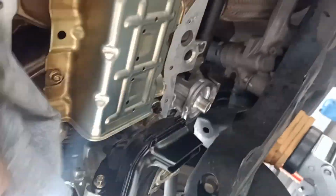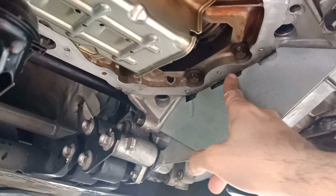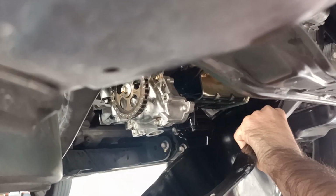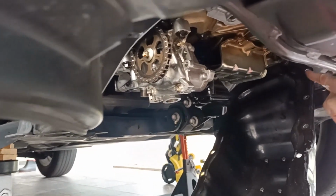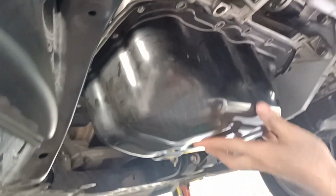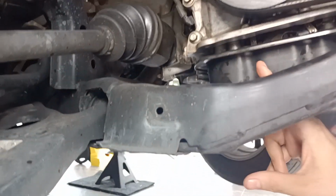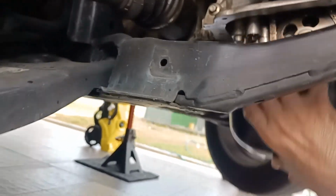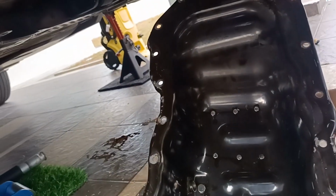So just clean it. There is a special way to put in the oil sump. Can you see the marking here? There is a groove. The oil sump will basically go inside here first, and only then you push it up. So this is the way you put in the oil sump. It basically hooks at the side there. Once it is hooked, then you push it up and you screw it in. When you want to take it out, you take out the cover, put in the screwdriver like I mentioned the first time, and slowly push down, so this thing will come out. You've got your hand here, you pull it down, and then you take it up. So there is a way to take out this oil sump.